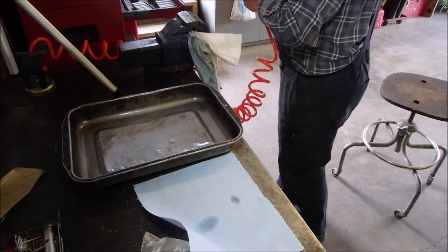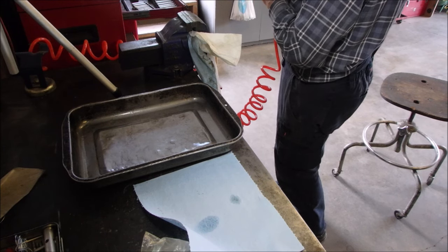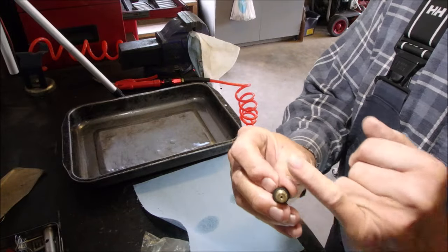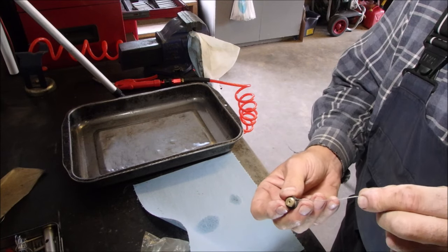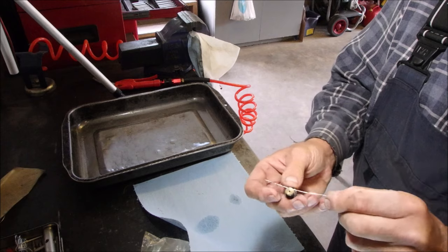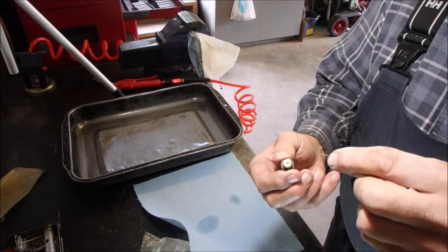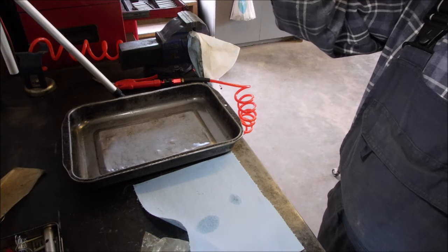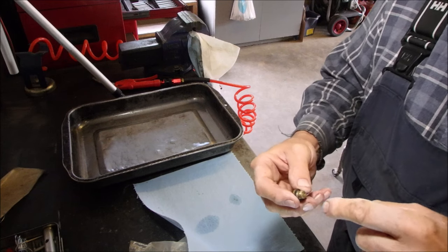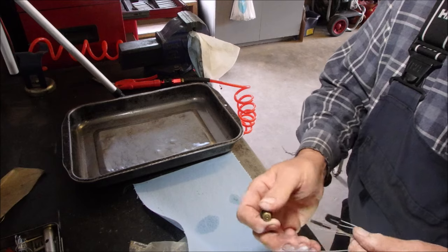Now I'm going to put a little air through it. So remember it was running kind of a little bit — well, this hole going sideways through here was almost clogged. If I put that through there — hold on. And down through here I should be able to see light interrupt. That doesn't feel right. I'm going to use one of these little twisted acetylene tip cleaners. Need a little thicker one — maybe that'll do.